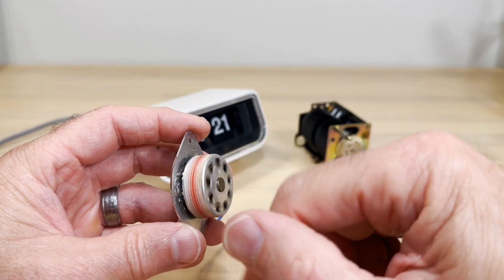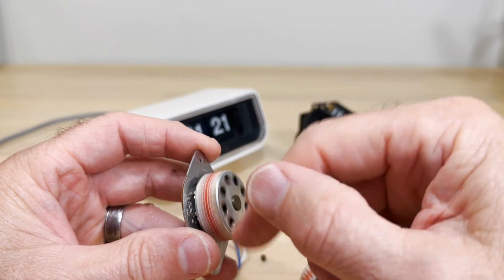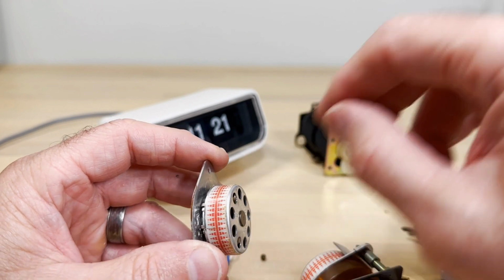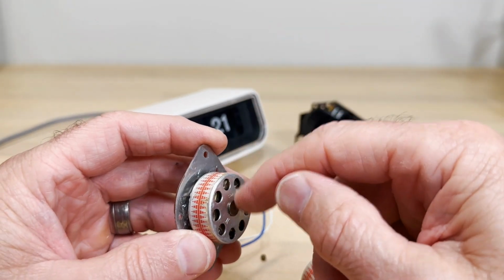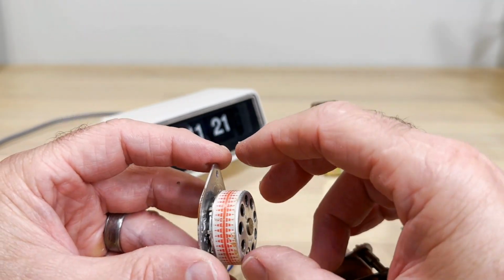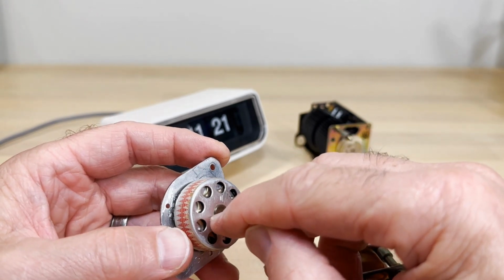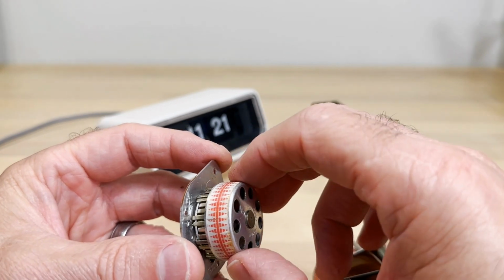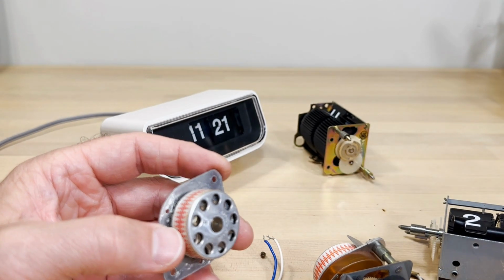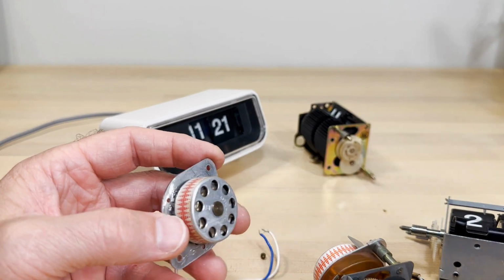Now, that's controversial. I have used alcohol sometimes on a clock that I just can't get to budge, and again, I moved away from alcohol. So sometimes when I'm desperate, if regular oil doesn't work, and you've got to give it time, you get the oil down in there, you spin it. If the motor's running, you let it run for several hours and put some more oil in there. That's the best way. But I have used WD-40, and it was the only thing that broke it loose. I don't know why. It has some kind of solvents in it. After that, you blow that out, let it spin a while. You want to get a good oil in there, a good clock oil, and you can get stuff like that online, liquid bearings and stuff like that, they call that.